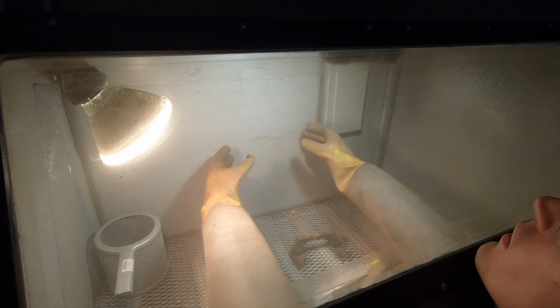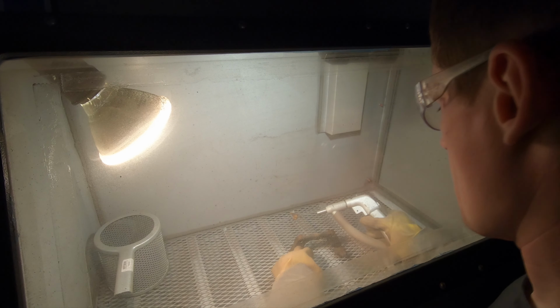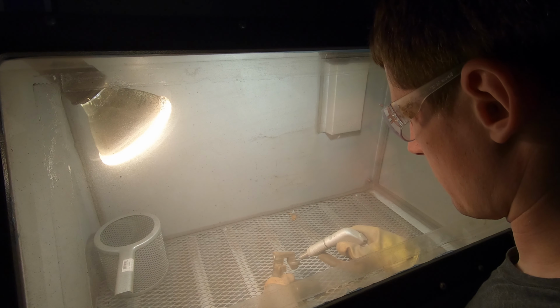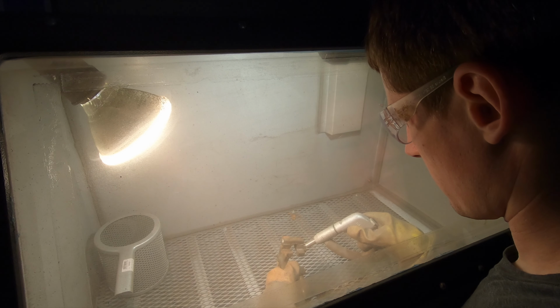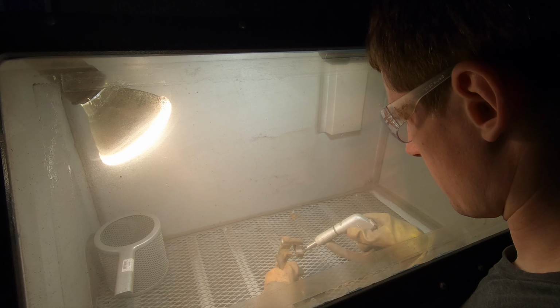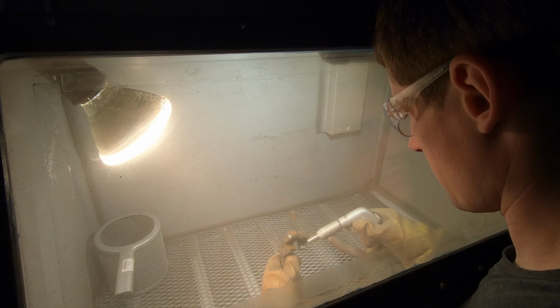As far as the rear caliper bracket, I'm doing the same thing as I did the front. I'm just throwing it in my sandblast cabinet, stripping it down, and cleaning it up that way. It's just quicker, easier, and cleaner for me to do it this way than with a file or a wire brush or a cutoff wheel or whatever. Like I was alluding to earlier in the video with the cutoff wheel, you can hit it real lightly and just knock the rust off, and it works great.